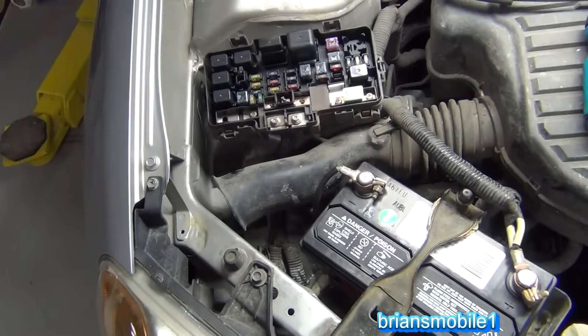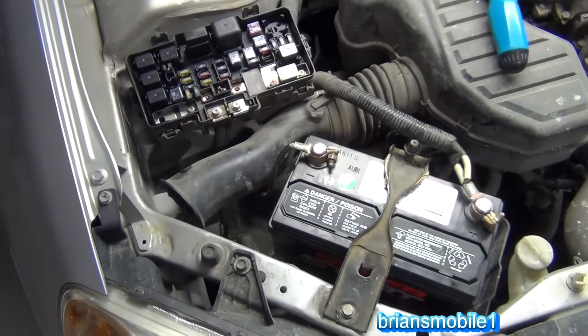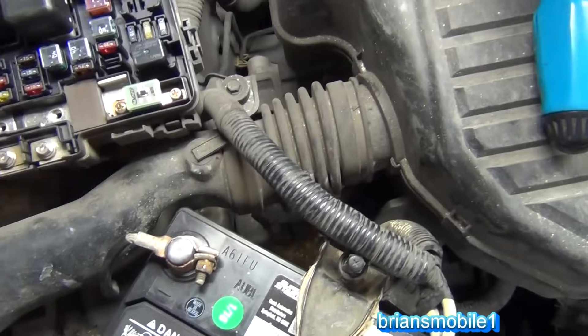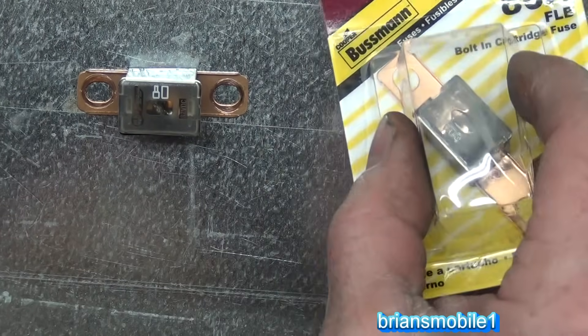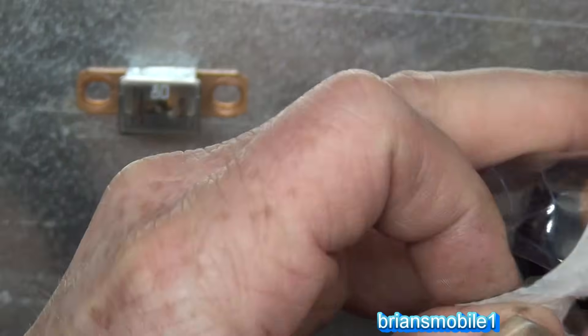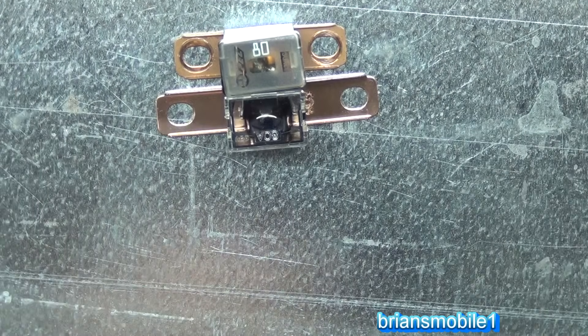That's what I did to get it on and off the trailer. Now the next thing we're going to do — it's a holiday weekend, everybody's pretty much closed, and I don't want to go out of town to get parts. We need an 80 amp main fuse. I went ahead and bought an 80 amp fuse so it's the right thickness to handle 80 amps and no more. We're going to make it fit the Honda. These replacement fuses almost never fit — the box is the same style, but the rest of it is obviously not going to work as-is.